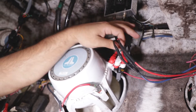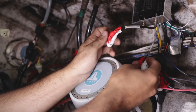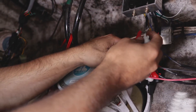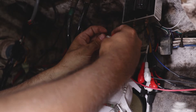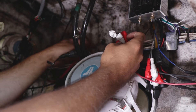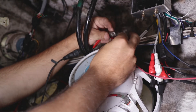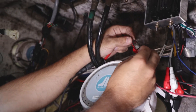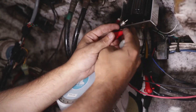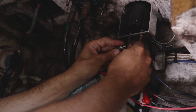We're ready to move on to the next step and hook up the amplifiers. The last step here is to hook up my two amplifiers. I have a sub amp, which will be going to the black wire, and I also have an amp for my speakers, which will be going to the gray wire. We're going to take these connections and line them up: red with red. Some of these wires may have a black connection instead of a white, but they're the same thing — so white would go to either white or black. Same thing for the speaker amplifier wire.